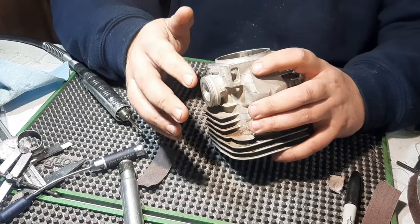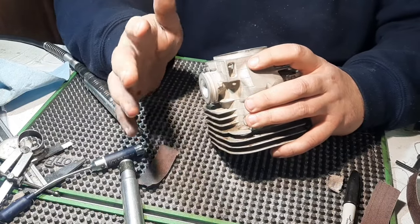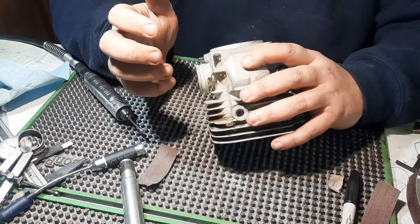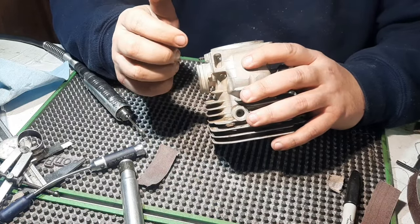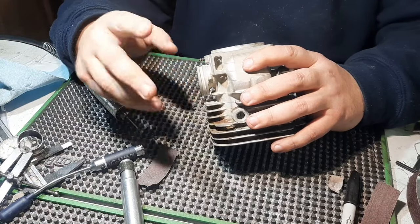Raising the transfers, opening the lowers, setting the exhaust - this will be a full start to finish of what it takes me to grind a 395 cylinder. Exactly how I do it, what I use, start to finish. Hopefully you enjoy.